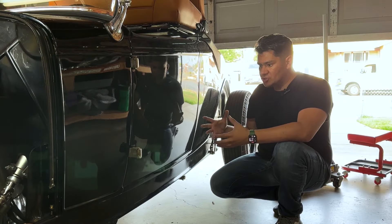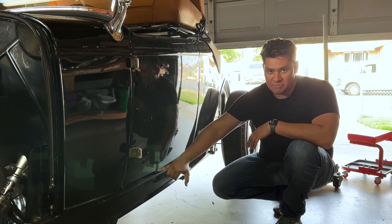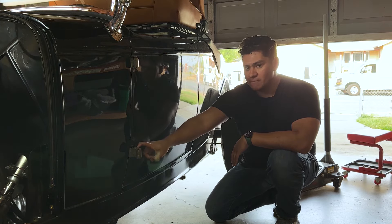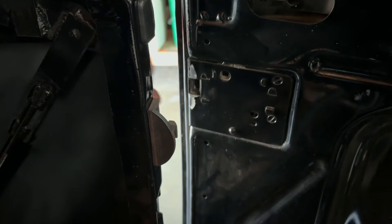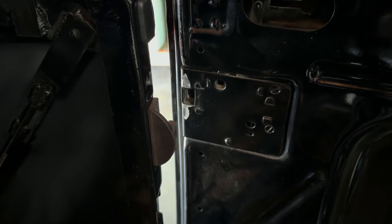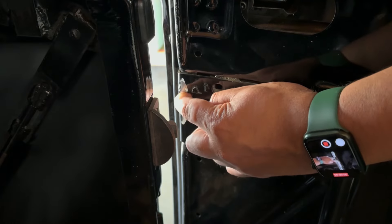When it comes to body shimming, what you're really trying to accomplish is a really clean door gap. This top gap is your main critical one — if this looks good, your bottom one should be ideal. There's not much control you have over your hinge-side door gap; to control that it comes down to heating up your actual hinges and tweaking them. Now if all this is set up properly, the back side should not be hitting the sheet metal. I like to pull the handle all the way open and then slowly close the door — you can see that nothing hits. If I let go of the handle, what's hitting here is this surface, which is the striker hitting on the actual lock on the door.